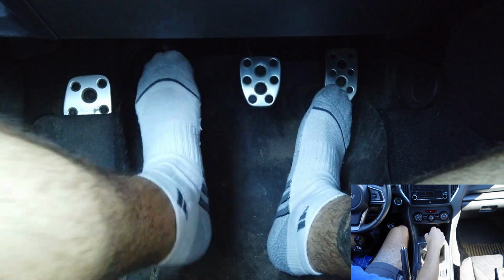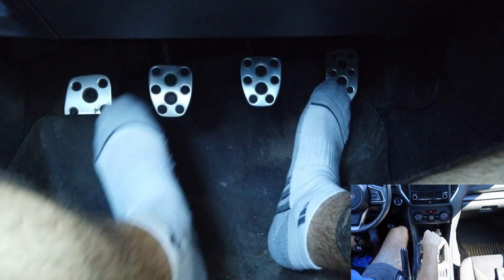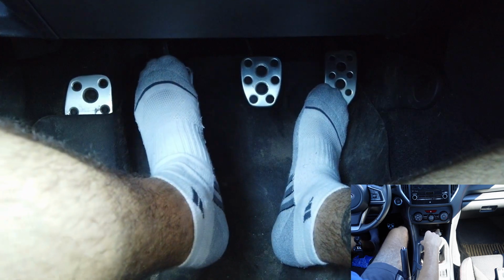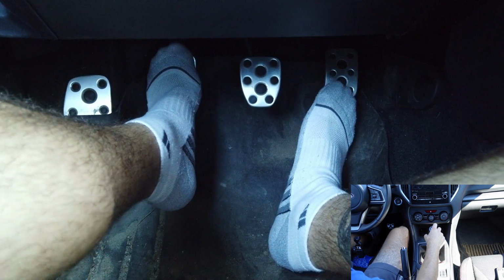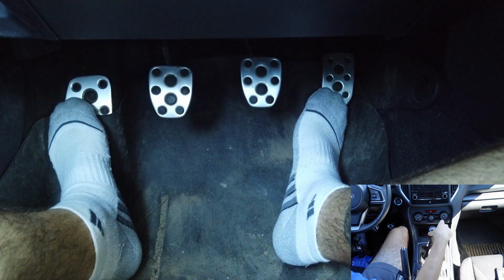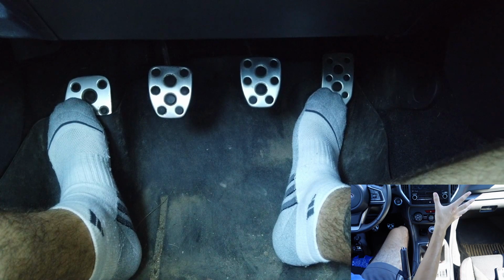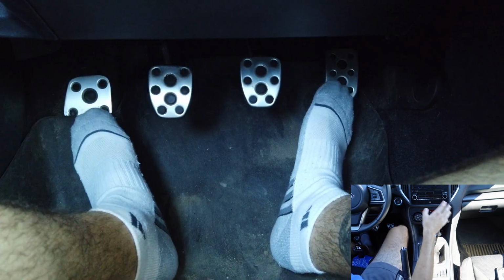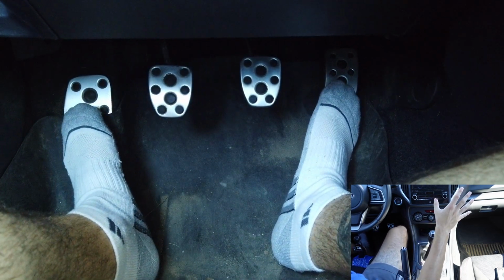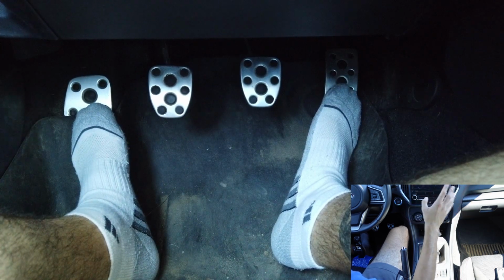then you shift. So let's say I'm in second, I want to shift to third. Gas, clutch in, gas off, move to third, clutch out, back to gas. Okay? And it's a lot more forgiving when you're moving, when you're upshifting. It is a lot more forgiving. You know, if you do a bad shift, you won't stall. You might feel it a little bit, you might shake a little bit, but you won't stall while you're moving.